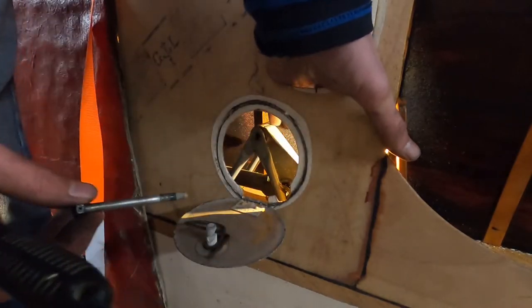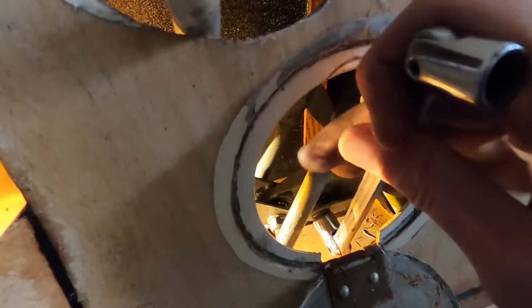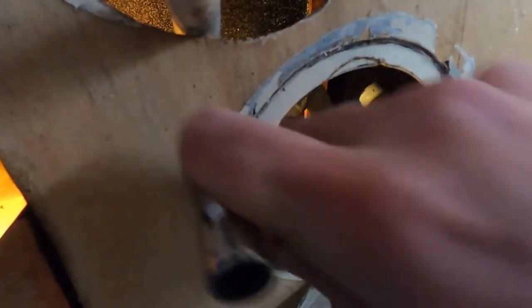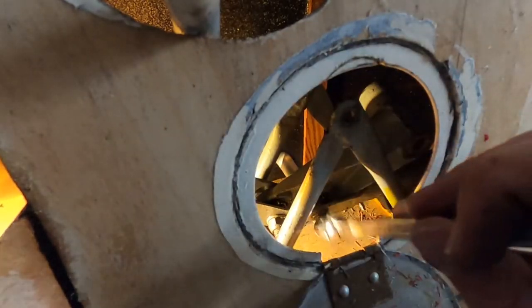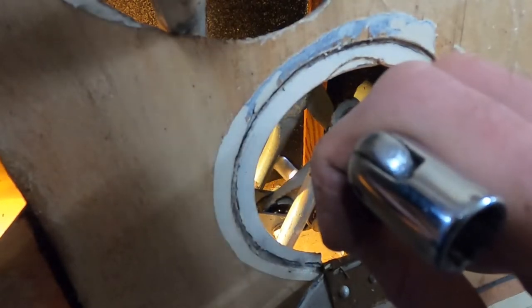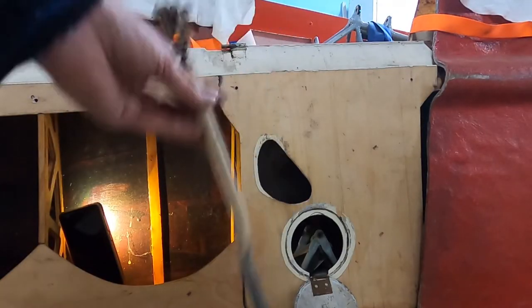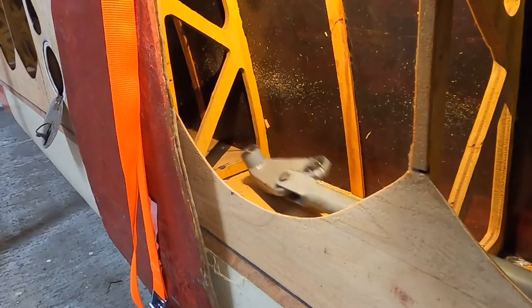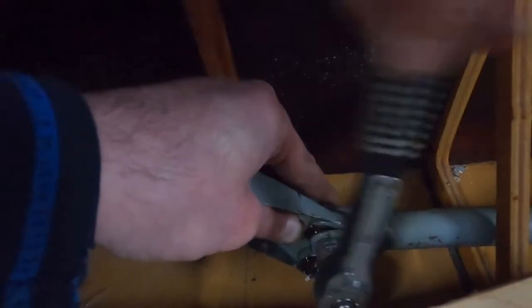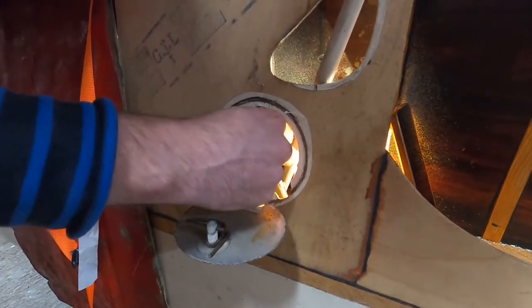With the wire removed, the bolt can be undone. I only later realized that the nut on the back is welded, so the wrench on the back was totally unnecessary. After the bolt has been taken out, the bell crank can be pushed out of the fittings that are mounted to the wing. I was hoping it would be possible to pull out the control rod with bell crank and all, but this does not fit through the wing ribs. This means that either the long or short control rod has to be unmounted — sounds easy, but it's really hard to reach these bolts with wrenches.